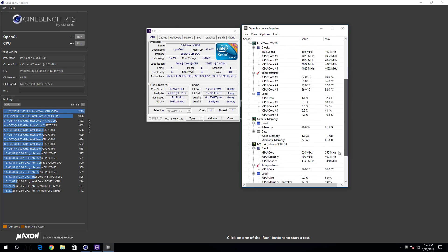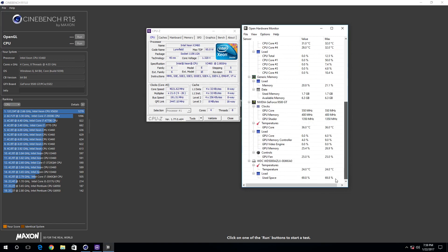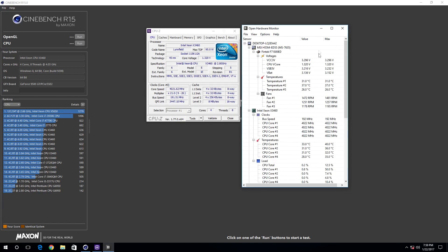As you can see, it is a 4-core, hyper-threaded processor on the LGA 1156 socket. Right now we are running a V-core of around 1.32, which is about as high as I want to push it on this particular motherboard. The chip itself can go quite a bit higher — maybe around 1.4 or 1.45 if you're willing to endanger your chip a little bit. This particular processor, people can get it up to around 4.7 gigahertz, but not on this motherboard.